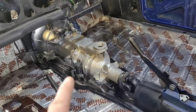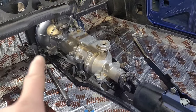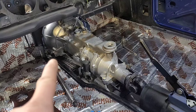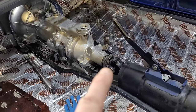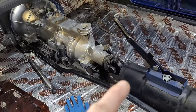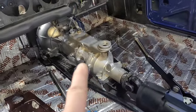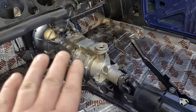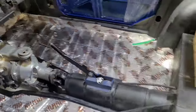I did take the transmission out since I came back because I found out that the shaft needed to be replaced. So I've had to replace the whole shaft and the fork, and also there's a lot of tension on the drive shaft, or the prop shaft, whatever you want to call it. So in the end, I ended up pulling the engine forward a slight bit, and that took the tension off here, so I actually moved the entire engine and gearbox forward. Other than that, great job.